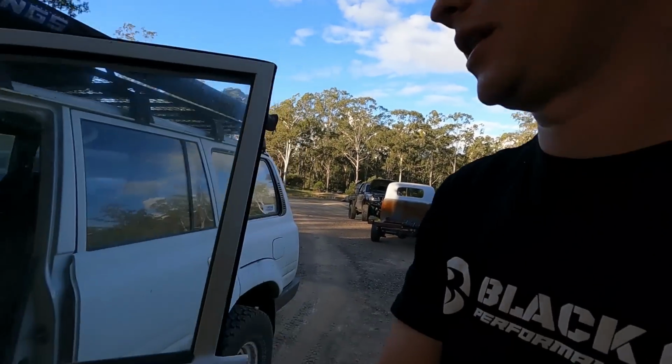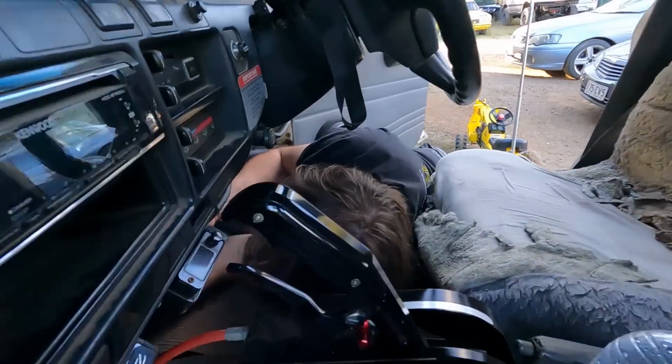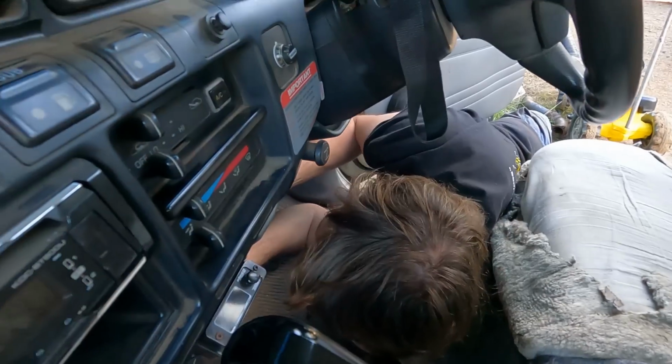The reason for that is that we've got an e-boost Street 40, so we can just set a duty cycle, but we don't have any RPM reference in it. That means the duty cycle we set for high and low boost is just that one set duty cycle for the whole rev range. At that duty cycle we're seeing our 14, but towards the end of the RPM it starts to drop off. What does it actually drop down to, Rex? It drops about 3 or 4 pound, doesn't it? Yeah, it's down towards 10 or 11 PSI.